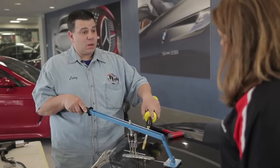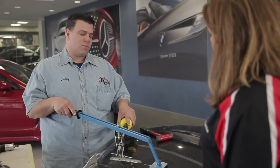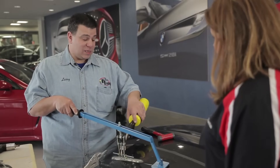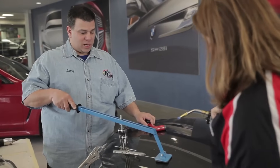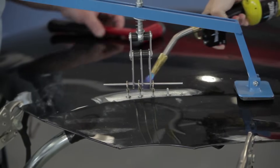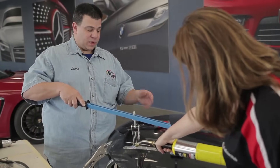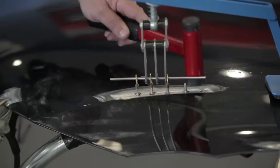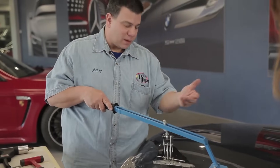I'd like you to come around the back here for a second — you can take the torch and squeeze the red trigger. When you use the torch, keep it in the area close to where the dent is and move back and forth. Remember, aluminum will never change color, so if you sit there and wait for it to turn red, you'll just see it wave and then disappear. Keep it going back and forth, nice and easy. We'll mock this up — I'll hold pressure here, you squeeze the trigger and move back and forth, and I'll feel this move up a little bit.